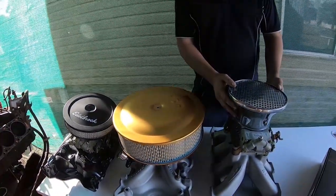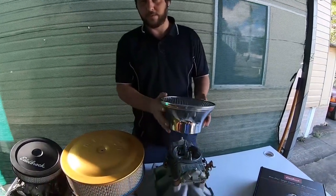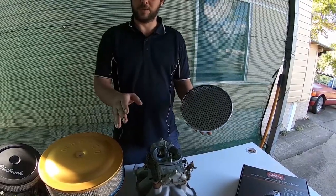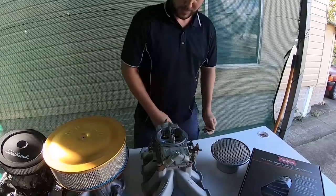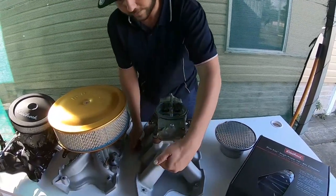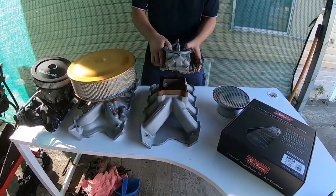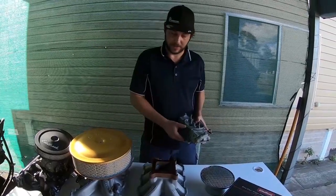This is a different style of air fuel intake — what they refer to as a velocity stack. They're pretty good for an engine dyno, or a dyno room, or a hot rod where you're going to be moving and you never plan to get stuck in traffic. Now, what we're running on this intake — this is a 2V TFC High-Rise, a bit of a race intake. You wouldn't fit one of these on a street car; this is more race-oriented.